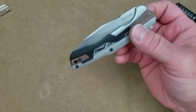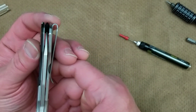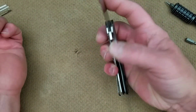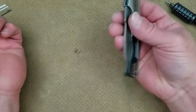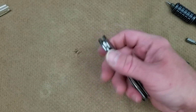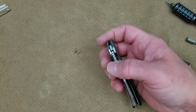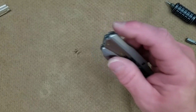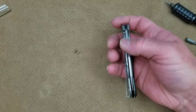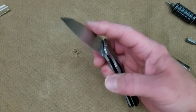If they're hard, put some heat on them. There might be a thread sealer on them that's a little aggressive. So there's our centering. That gritty sensation is... Now, of course, the one side of the pivot had the washer on it, and I did flip the washer over to the smooth side, but the other side was scored into the frame. So, you take what you get out of that.